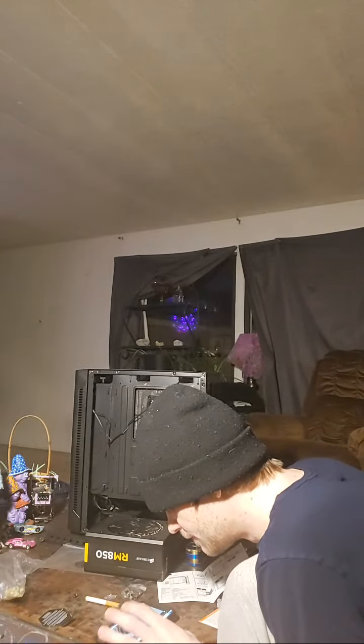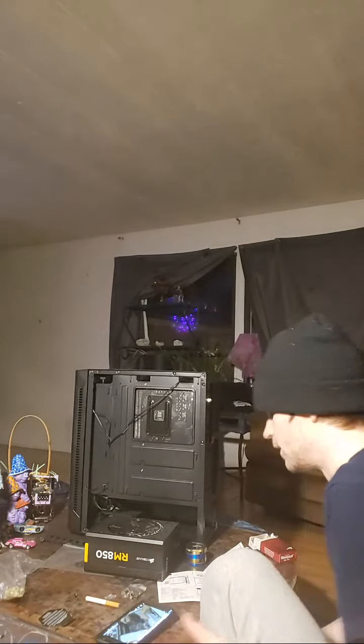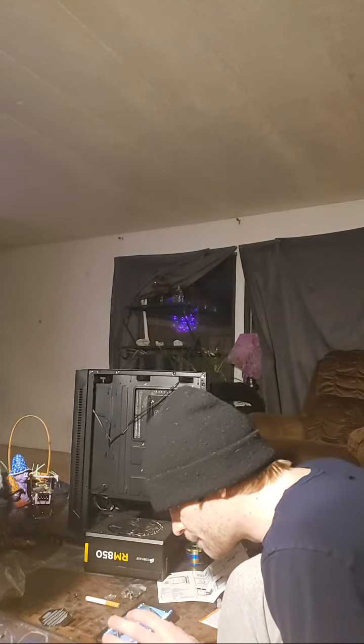Yeah, this is my 24. And then I just sort of push it in there, just gently. I like to look at the back of the motherboard. This is a 24 pin. We only have to do 8 because the middle standoff is a raised one. But if it's not connected, just like all the other ones, we'll have to put a 9th screw right there. And voila, now we can say our motherboard is properly installed.